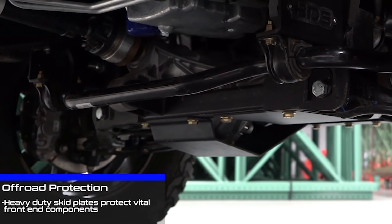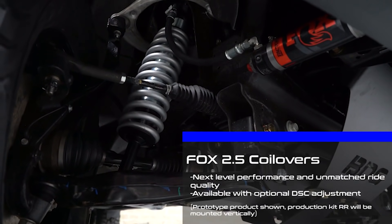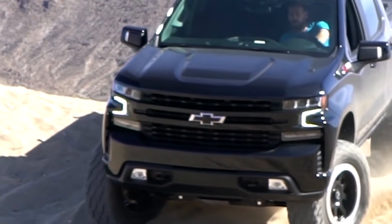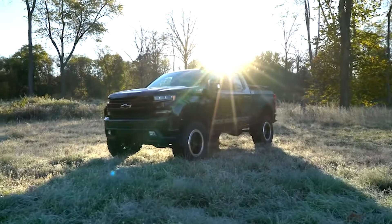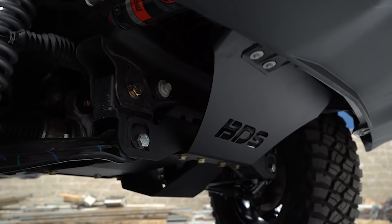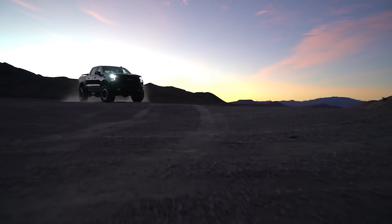If you want to go more intense at the four-inch lift height, the most popular full cross member kit would be the BDS four-inch kit. This kit differs from the SST four-inch kit by having a drop cross member, differential drop, and bringing all of the components down for longevity and performance at that four-inch height. This kit is specially designed to offer improved off-road capabilities while maintaining on-road handling and comfort, improving ground clearance and allowing more wheel fitment options than any other kit on the market. This kit comes with a pair of quarter-inch thick laser-cut high-clearance cross members to maximize clearance, allowing the OE lower control arms to mount up nicely. Also included are skid plates, knuckles, and all the other goodies that allow your truck to maintain proper steering geometry while still allowing a wide range of fitment options.